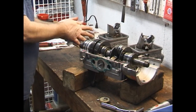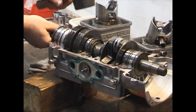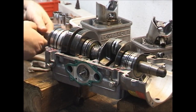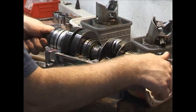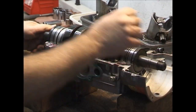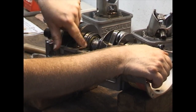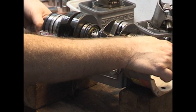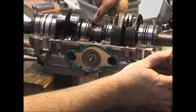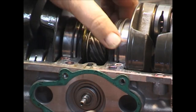I'm going to get my rubber hammer — just one tap gently and see when it starts to lift. You don't want to keep pulling up because that's putting these bearings in a bind. You just want to kind of wiggle back and forth. As you notice me taking this out, I also want you to focus on how those inner seals actually fit into a groove. The sealing surface is right here underneath these little spring rubber bands — those rubber bands help hold it tight against the crankshaft, but that's where it's sealing.